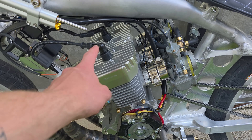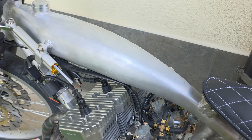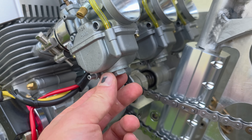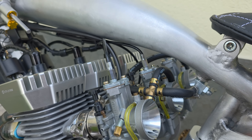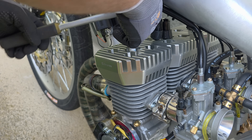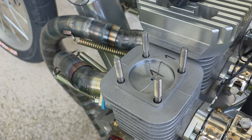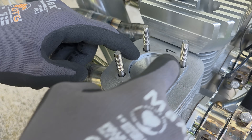Now I want to remove the first cylinder head and put in a wire to measure the squish gap because I don't know how much squish gap I'm running now. Changing the needles or changing the main jets of the carbs is very simple because they're right here with very easy access. When measuring the squish gap, make sure you put the wire in the direction where the piston pin is, not the other position, because the piston wobbles a little bit — it's supported in one direction, not the other.